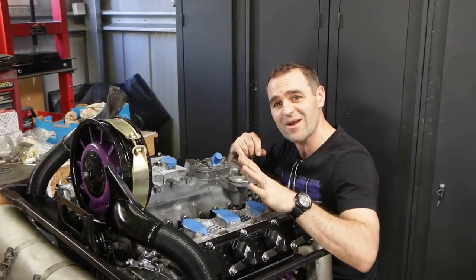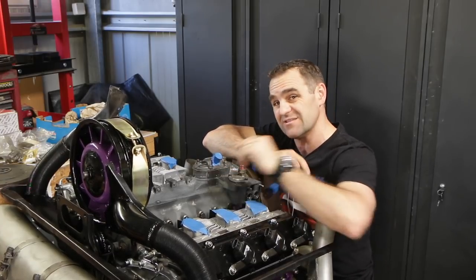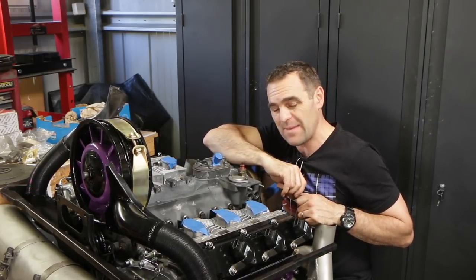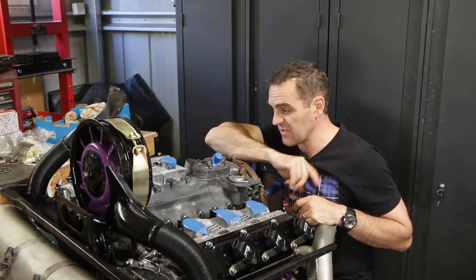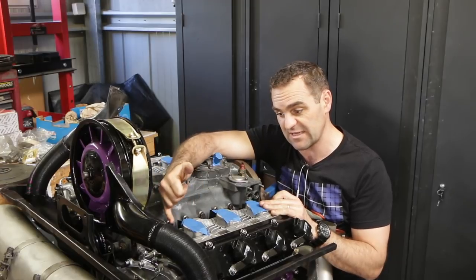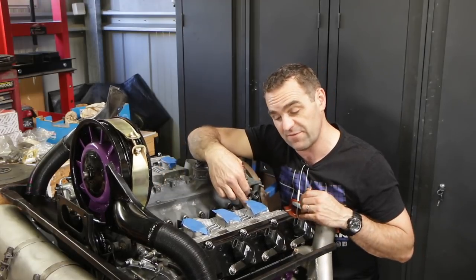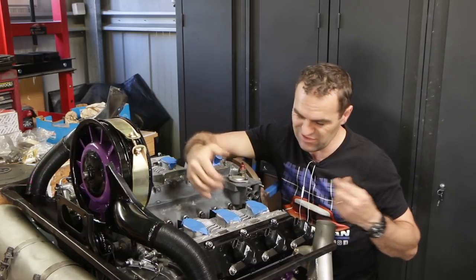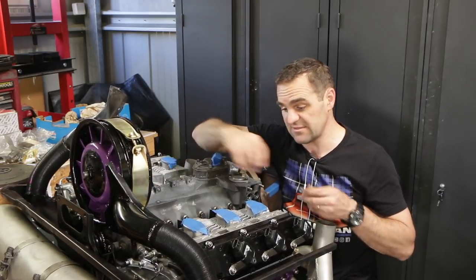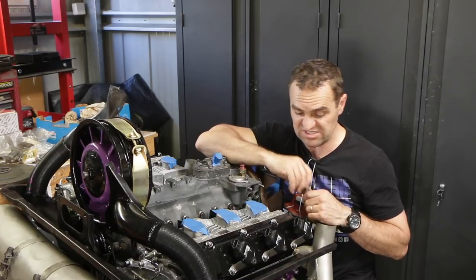It's time to come back to the engine. Before I can finally set it up for EFI I need to install a couple more sensors — specifically knock sensors. I've done a bit of research on where other people have installed them. A lot of people use the later 964 engine setup which had a bridge — basically a bracket that joined up all three cylinder heads on either side where you could bolt the knock sensor.